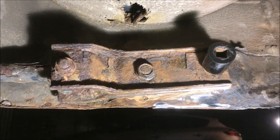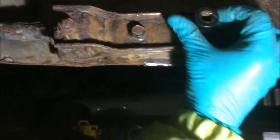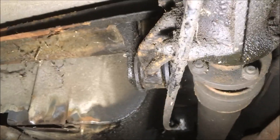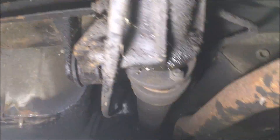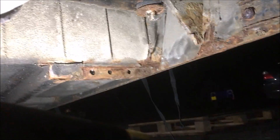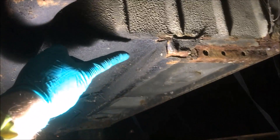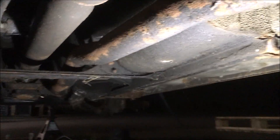I think I'm going to call it a day — it's about half seven and I'm a bit cold. But a general tour of the underside: there's the prop, this is the torque tube extension and the bush housing for that, and the cross member — all looks good. This is the heel board on the other side, and what the chassis rail should look like. The floor has got some surface rust and a bit of crap in that corner, but it's all much more solid. Look at that seam into the sill — all really nice. Compared to the other side it's great. The floor has been pushed up a bit here by careless jacking or forklift activity.